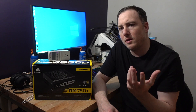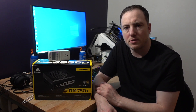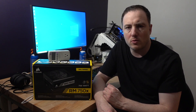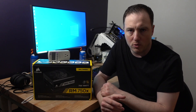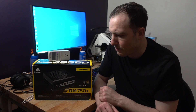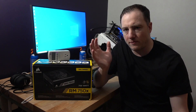Whatever you think you need, you might need a lot less. Just use those online power supply calculators, figure out what you're going to need from those, and then give yourself some headroom — maybe 100 to 200 watts — so if you want to upgrade or do some overclocking in the future, you'll have room. Even if you're buying top-tier parts now, still give yourself a bit of room, but don't go way outside of that because you'll lose a lot of the efficiency from the power supply.